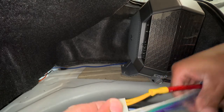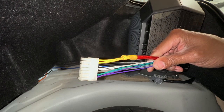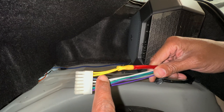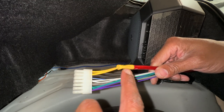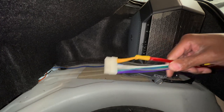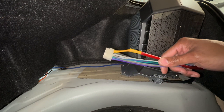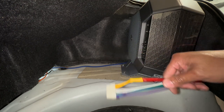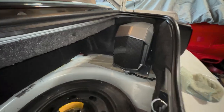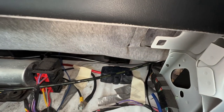Here's my solution to the horrible thin wire coming out of this plug. You have this 18-gauge whatever, so I just made a real short piece connecting it to 6-gauge wire. I'll plug this in, figure out how much wire we need, cut it to the appropriate length, and figure out how to do the carpet. The subwoofer is now mounted and the wires are routed. I have a fuse box here and one right by the battery too.